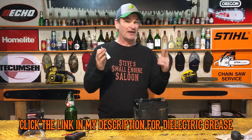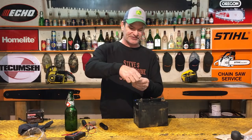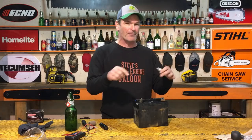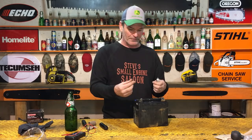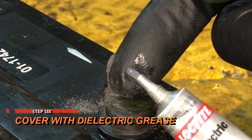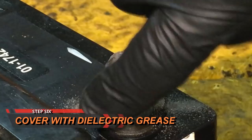Once those are clean, apply some dielectric grease. This is what's recommended for all electrical connections, especially battery cables and terminals. Wipe everything down with dielectric grease when putting it back together — it's going to prevent corrosion from coming back. It won't stop it completely, but it will definitely prolong the time before corrosion returns and provides a good connection. Just squirt a little on your finger and wipe it all over the terminal and the battery cables.